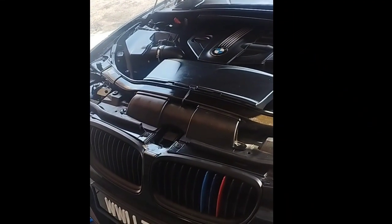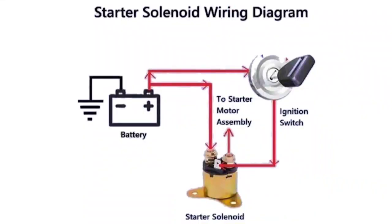Number 3, now I will check the condition of the car starter. All car starters are the same, 2 wires, one big and one small wire. Big wire battery supply 12 volt and small wire ignition is the start 12 volt. You can check the battery supply voltages with a multimeter, but I check with a test pen to see if there's a battery supply volt line on the large wire.